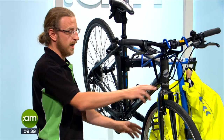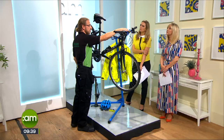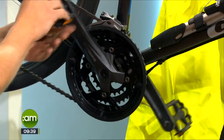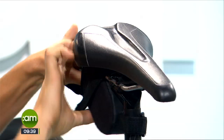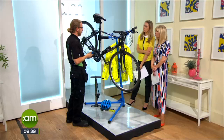Moving up, we cover the controls area. With just Allen keys — small tools you can keep in your saddle bag — you tighten everything up and make sure it's secure. Moving down, we make sure the pedals and crank arms don't move side to side — they should be firm — and that the pedals move smoothly. Finally, moving up to the seat post and saddle area, again just a quick tighten. All the tools fit into a little bag, and you can get Allen keys very cheaply — about 10 euro — along with a puncture repair kit. Very handy to have your own toolkit on the road.